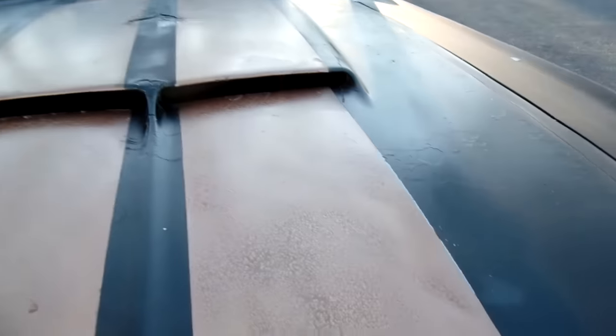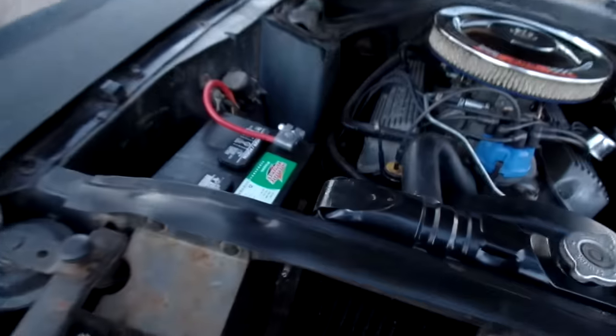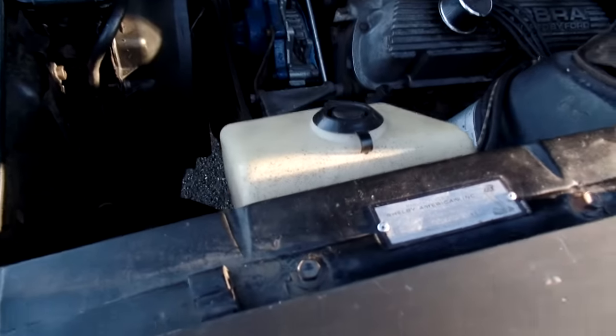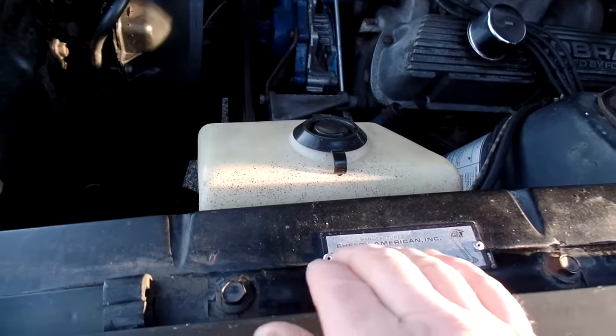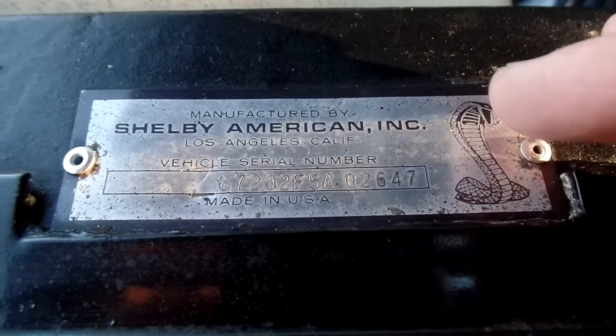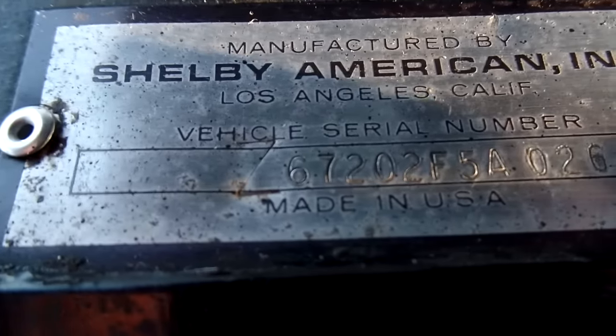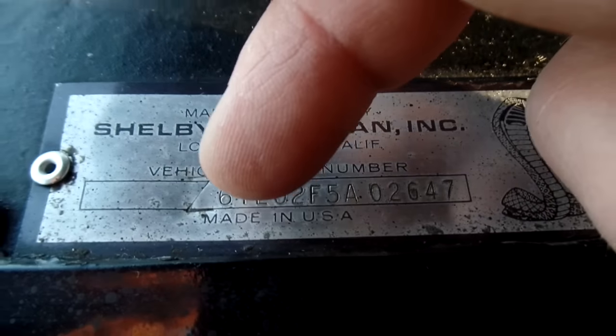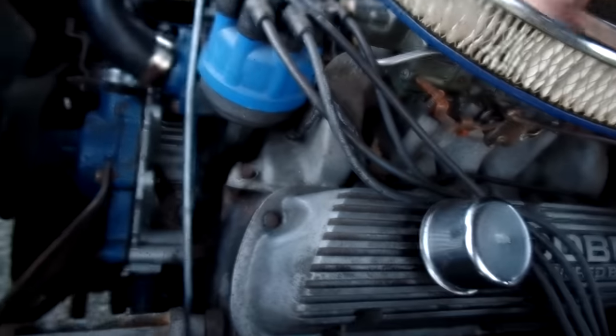The engine aprons are all good on the car — that's important to me. It's never been in a front-end accident. All the spot welds are there, it's all real clean. The shock towers look good. It's got the typical rust at the top but the original spot weld is right here, which means that panel's original. Underneath this was a very nice clean Ford VIN, nicely stamped. I know how Ford stamped them — the ones that are stamped crooked are not original; these should be almost straight. That number has been verified with the club, and that is the original Shelby tag. It's got the Z in front of it — I think they put it there just so no one would add a digit, though I could be wrong.